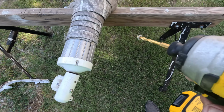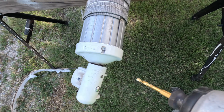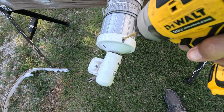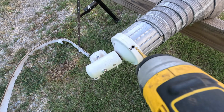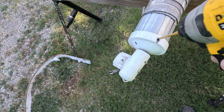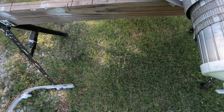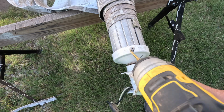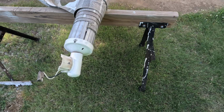See, now the rivet head is off. Then you can see the rivet's still in there, so you just walk it around and eventually, there, see, it went right on through. The key is just to walk it around in circles. Anyway, I've already drilled out 2. This is the last one holding it in, but I'm going to mark everything first, and then I'm going to drill that one out, and then I'll pop that motor end out of there.